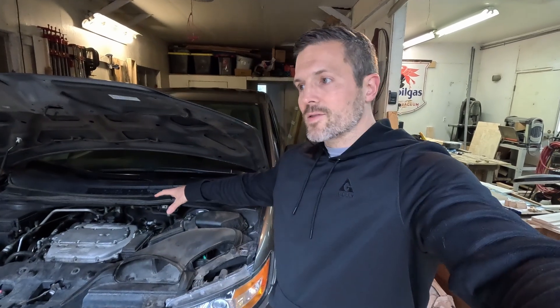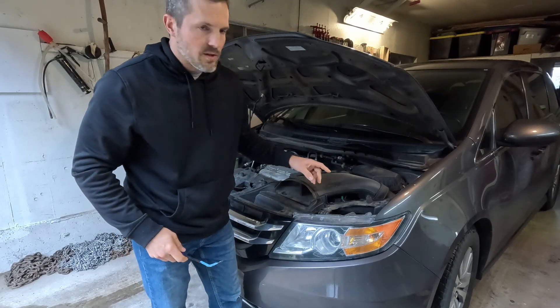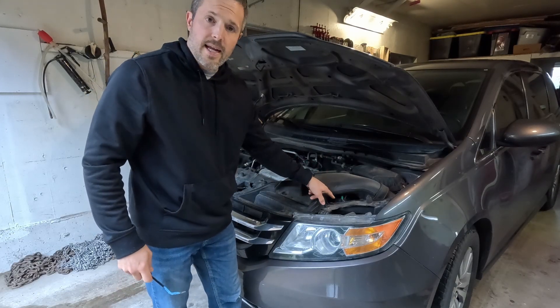As you are driving, you're consuming electricity that's coming from the battery. Your alternator is running at the same time — it runs off the belt and it is charging that battery back up. So you draw electricity out to start and run, and you add it back in with the alternator. If your alternator is not functioning, it could also look like your battery is dying. So you may need to charge your battery before you can really test it fully. To do this test, we are going to use a multimeter and we need to get access to the battery.